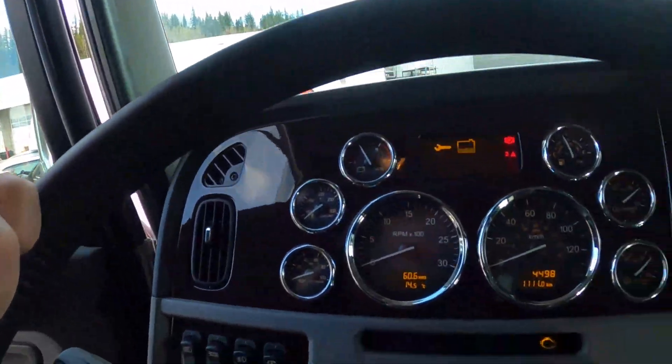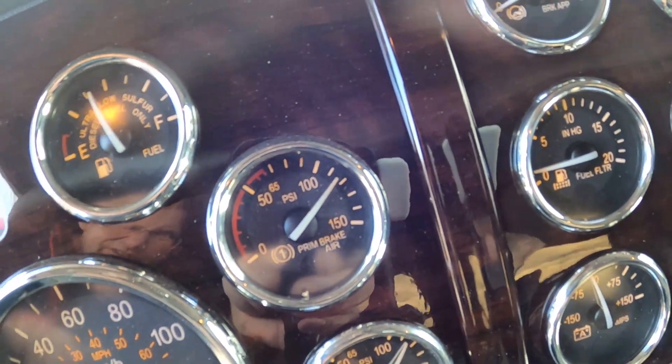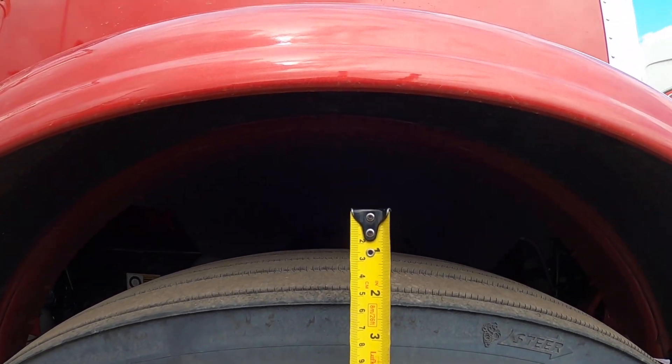A little bit of a change in plans — I didn't realize that the coolant lines weren't plugged off going to the DEF tank since it's not on there. So I'm using a service truck. We are now up to 115 PSI. I used the air-up chuck, and if we look over here, this is the height that you gain from dumping your air on a 13.2 front axle. I measured it — you're a full two and a half inches from dumped to aired up.